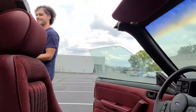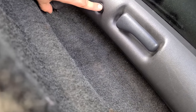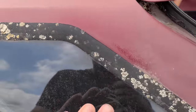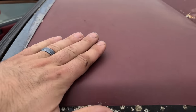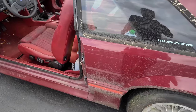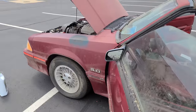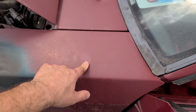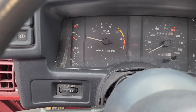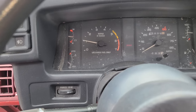You can lock the T-tops from the factory on this car - that is so cool. Oh wait, I can lock mine too - I've never done that before. The key has never gone near my T-tops. I can't wait to pressure wash this car. The paint is definitely faded - I think we're going to see a big improvement by buffing this car out, but there is some clear coat failure for sure. We might be doing a little bit of minor paint work. We've had this thing running for about 20-30 minutes now - heat is coming out nice and hot, it's not overheating. It's running very, very cool though - it could be a gauge issue. We have a brand new thermostat in there.